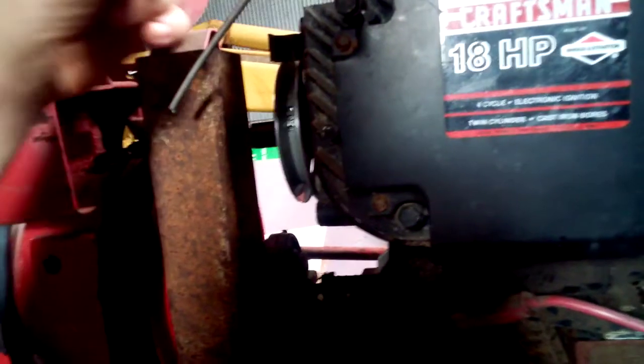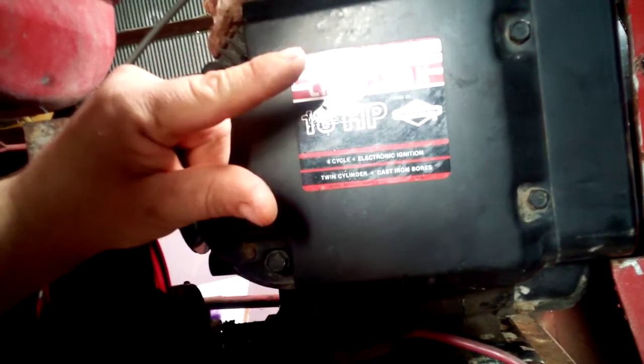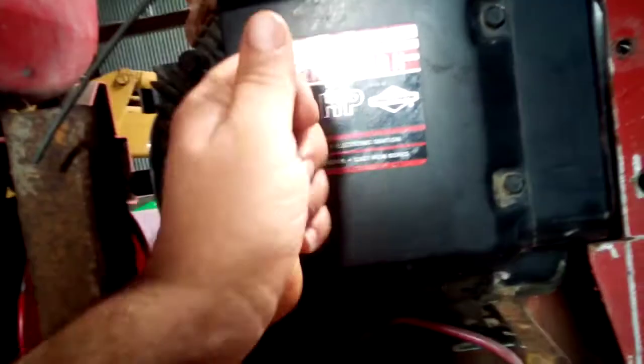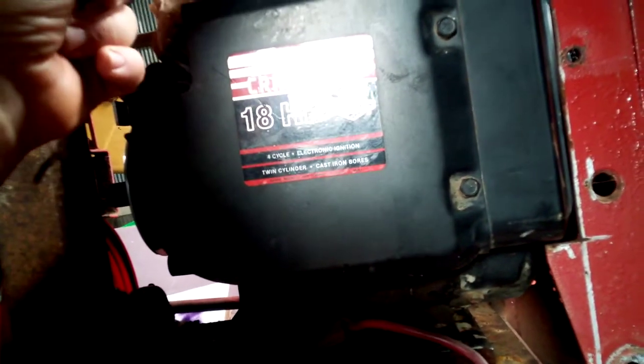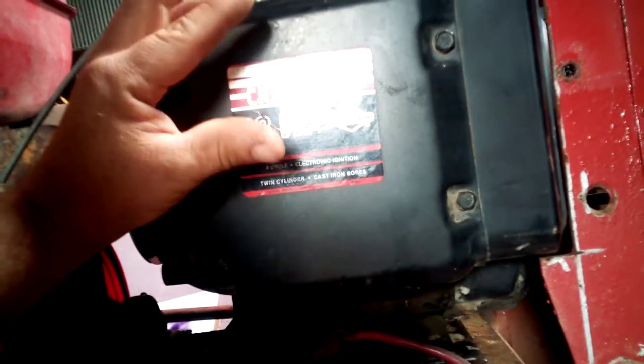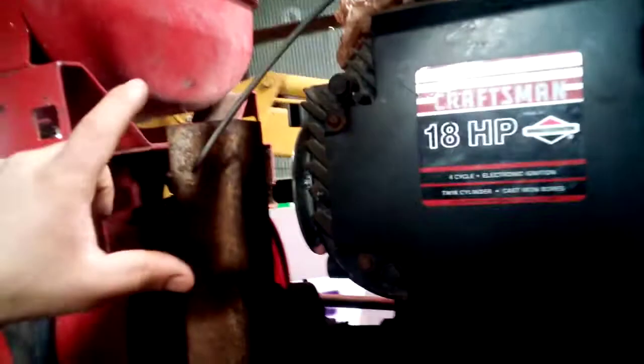And the idea I have for the belt tensioner, because the engine rotates this way, you want the pull side straight. So the idler would have to be on the bottom. And on this side, the idler would have to be on the top. So my idea was to have an idler bracket that spreads like this off of one point, with a turnbuckle to spread the two apart, but it would also have a slotted link. Once you spread them apart, there'd be a bolt you tighten to keep the pressure off. So as it's on the machine, it's always constantly adjusting both.